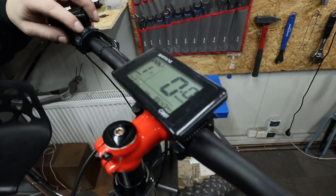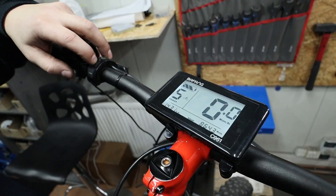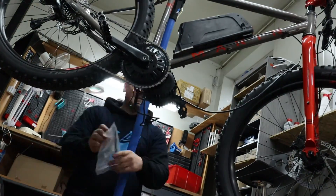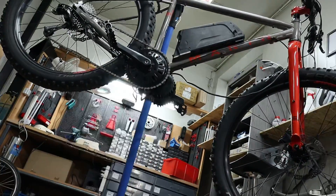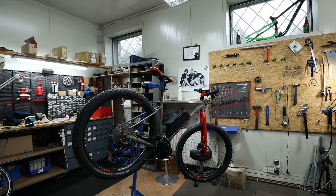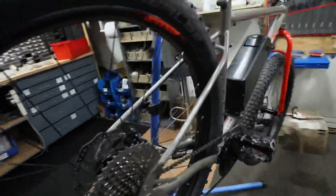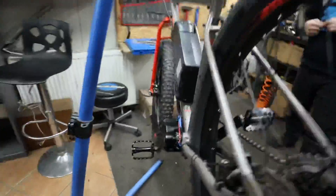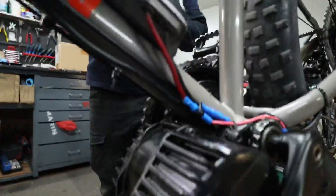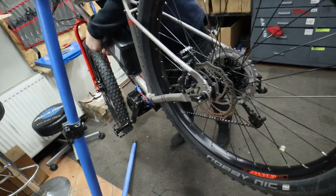It's alive! The display is on, it has backlight and different levels of assistance. Even though it's not a torque sensor, you can select various electric assistance power levels at different speeds. The throttle is always at maximum power. Here's a time-lapse of arranging all the cables with cable ties. Tobias connected everything with zip ties so the cables are routed and all connections are pretty much hermetic. We're ready to take it for a spin!